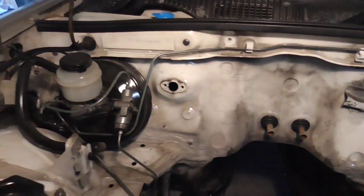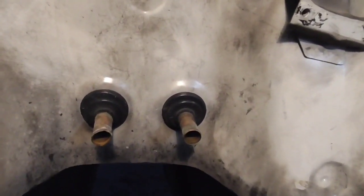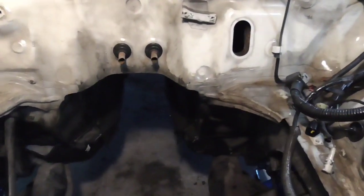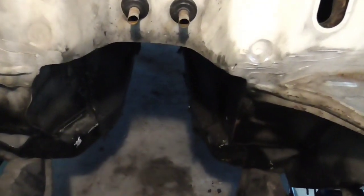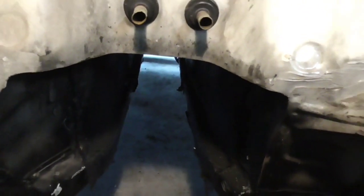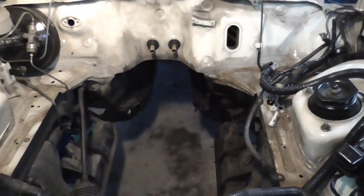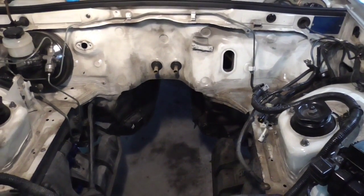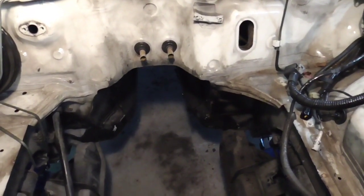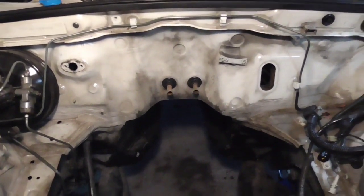And another little update here. Heater core: originally I was going to take it out, but I don't think that's such a great idea, because we are going to have a chill plate for our controller, and it's going to be right there in front of the motor, which is going to be behind it. So I'm thinking, well, we're going to need some sort of cooling system, we're going to need some sort of heating system, so why not take that heat that's definitely going to be produced off that chill plate and use it to heat the interior of the car? I mean, it seems to make sense.